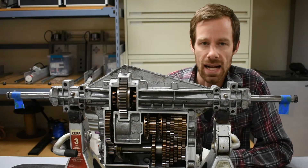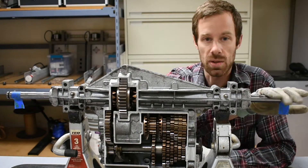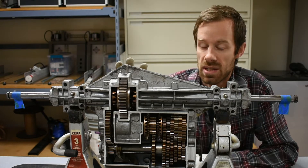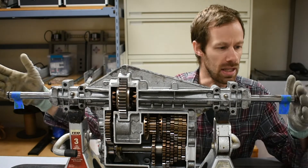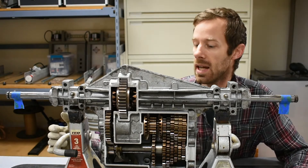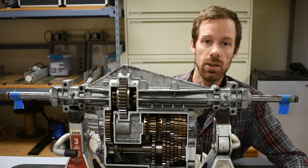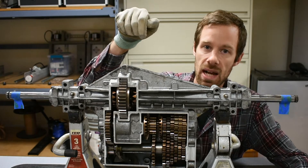Now this is more of what we call a transaxle because it not only has the transmission part, which is the set of different sized gears, but then it also feeds directly to the axles. That's actually pretty similar to a front wheel drive vehicle. Now this one's out of a lawnmower, so not all transmissions look exactly like this one. But they all share this same kind of setup as to how the gears work together to change the speeds and the output torque. I've put a couple little pieces of tape on the end so you can see the rotation and watch how fast I'm rotating the input compared to how fast the output is rotating. So let's take a zoomed in look at the gear sets and identify the key parts before we start spinning it.